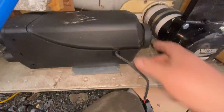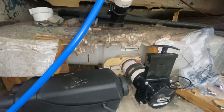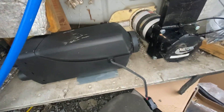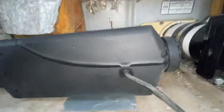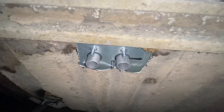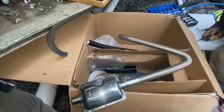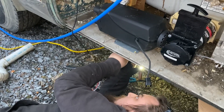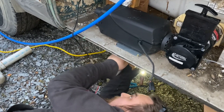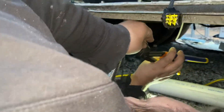We're working on installing a diesel heater in Tyler's bay. We've got it ducted up to go into his bedroom and bathroom for now. It runs off 12 volt — these things are awesome, I've got one in my bus. It's a really simple installation: it just has an air intake and an exhaust on the bottom, and we're going to run the pipes to that. It's about an hour job. We're just hooking up the fuel line on the bottom, plus the intake and the exhaust — about five more minutes.